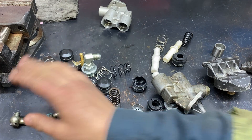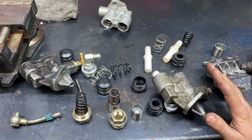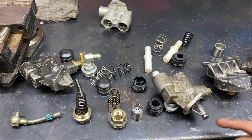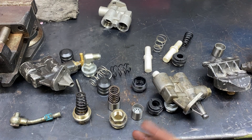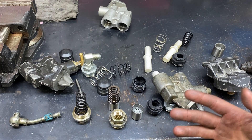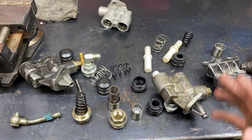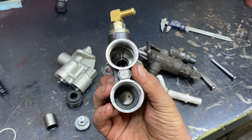That's a kind of extreme case scenario. I had a 13mm P-pump running everything I've described here — it made good power and good fuel pressure. It's a great budget alternative for guys not wanting to get into a FASS 150 or 250 GPH pump. And of course, you lose the mechanical aspect that is so great about the 12-valve, where there's no electronics needed.